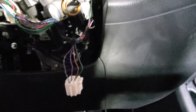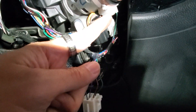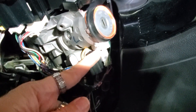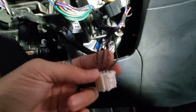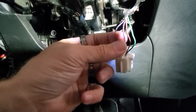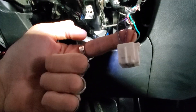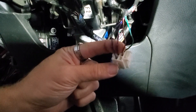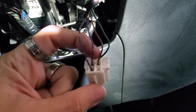Everything goes with the ignition switch and over here at the fuse box. So we unplugged this plug here. This is the ignition switch right here. You're basically going to have brown with red, purple, and then blue with red. Those are going to be your three ignition, accessory, and start wires — the three that you will want to use right there in those pin locations.